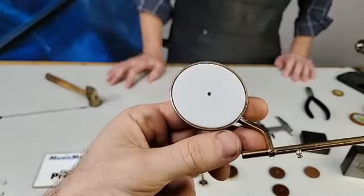This pad is a... because we've got a 48 mil cup. This is measuring 46.75, so it's like a 47. This is a 47. Way too small. We know the cup is a 48, so obviously a 47 is not going to fit.